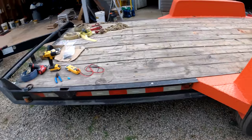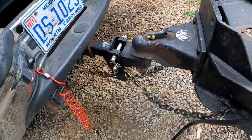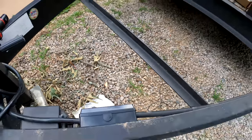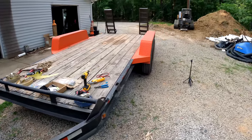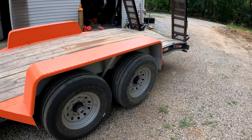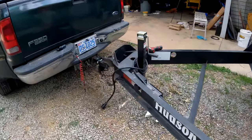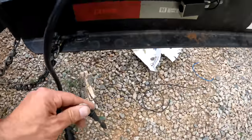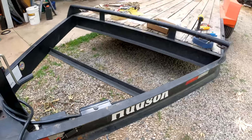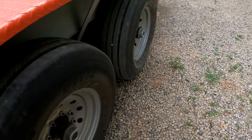And so that's what that breakaway system does: when this switch pulls out, it connects the battery to the trailer brakes and applies them, and hopefully that'll stop the trailer much, much sooner, causing less damage and problems. So now when I plug this thing back in, the link will be broken. Well, you can even hear it, it's like a click over there. And then we're loose again.